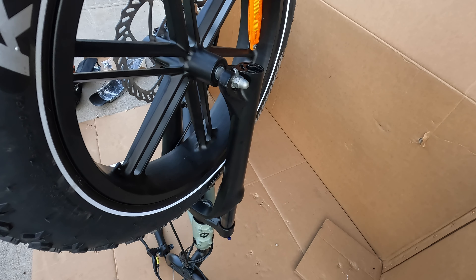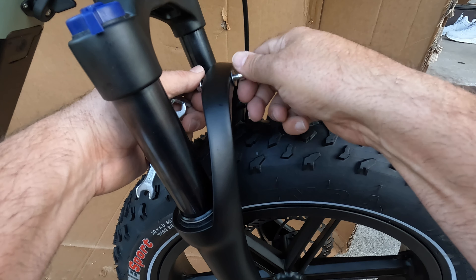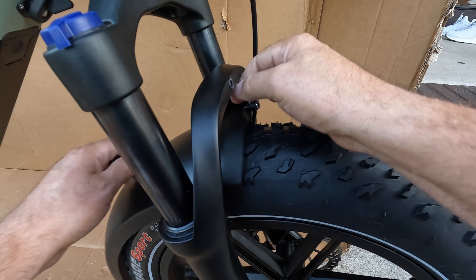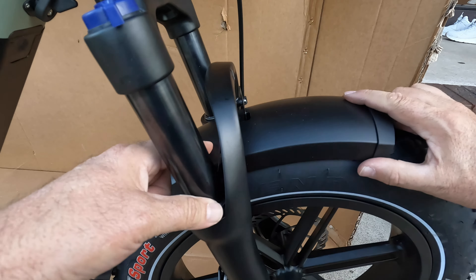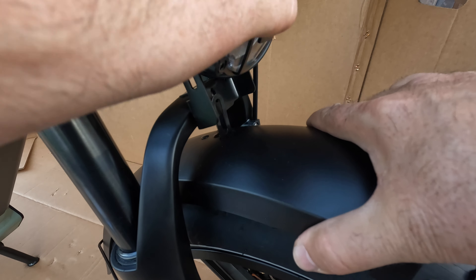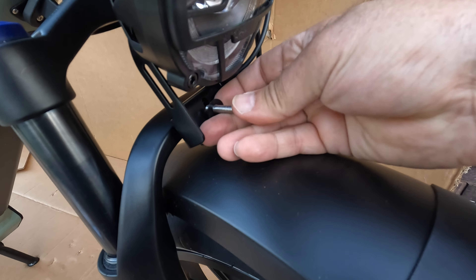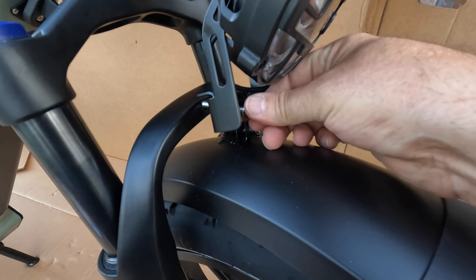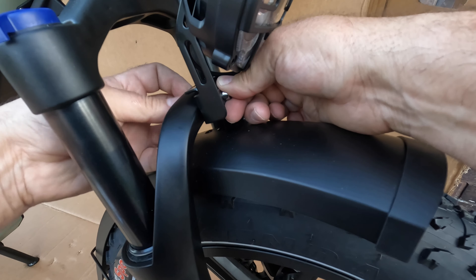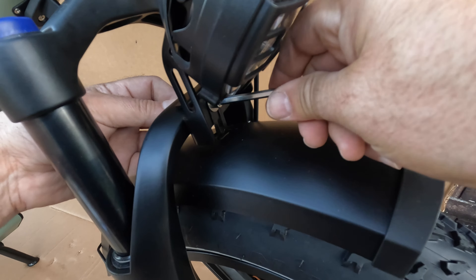Let's go ahead and put the bike right side up. Install the front fender and the light — they're both going to use the same screw right here. We'll bring our fender around the back side and come up through the bottom. The way we're going to assemble this is we're going to put our light on, and we're going to put our fender in front of the light so that we can move the fender up and down. So we're going to put our fender on, then our light, and feed it directly through and tighten it down with our Allen wrench while holding the nut on the back so it doesn't move. Don't worry if it flops around a little bit — just get it into position, then you can adjust everything a little bit tighter after.